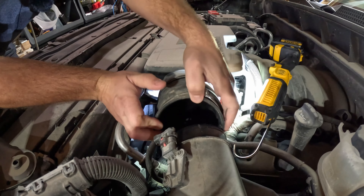Let me take a look at these side by side. That's the new belt — there's plenty of groove there. The old belt — there's not near as much left, the profile is quite a bit smaller. Apparently around 60,000 miles these serpentine belts are shot. Super Clean is doing a great job getting all that grease off — highly recommend it if you've got to take off some belt dressing like I made the mistake of using.